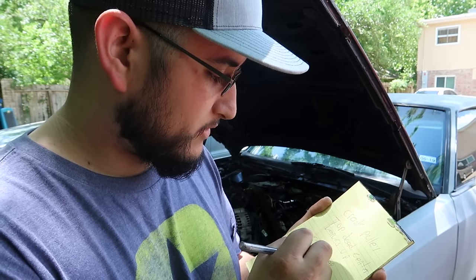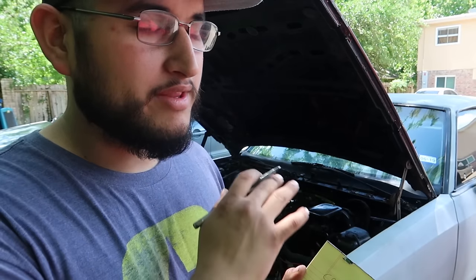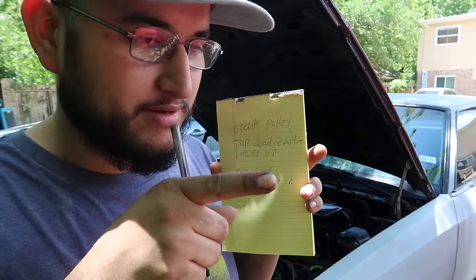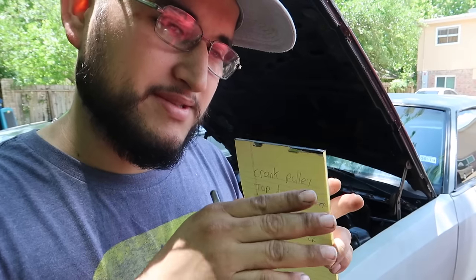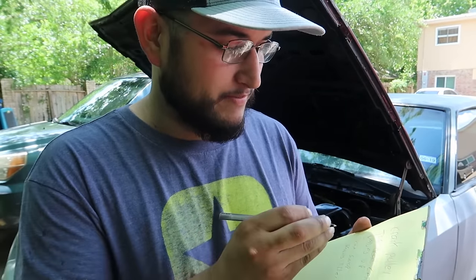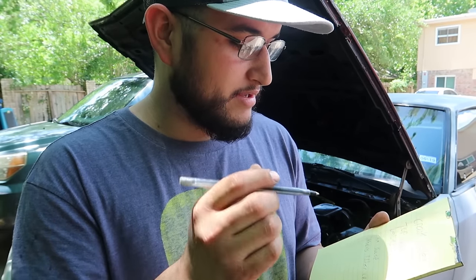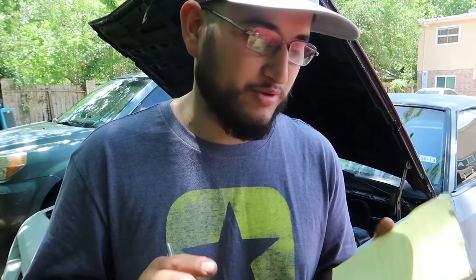I also get questions on how to keep the lifters up. To keep the lifters up, all you do is spin the cam and push the lifters into the plastic trays. On a low-mile clean engine the trays should be tight enough to keep the lifters up on their own, but a lot of these LS's are getting old with high mileage. There are two holes - top left and top right of the cam - if you put two rods in there it sandwiches the lifters in place and keeps them from falling down.